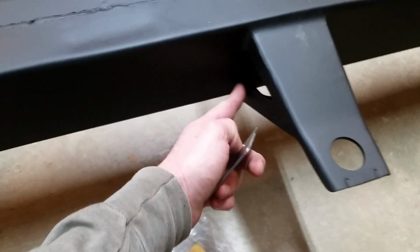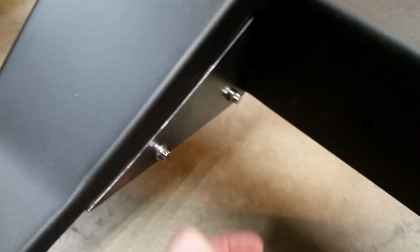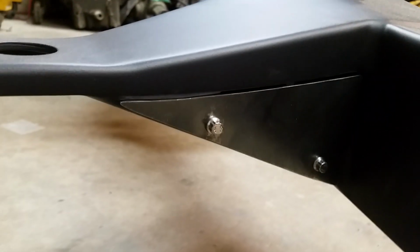I had these made a long time ago, and then I went through and cut the flanges off these body mount edges. Probably easier to see this one. Frame's all dusty, but I beveled these. This is all weld I built up in here, and then I used a ball burr to hone it out a little bit. I had to do a little bitty notch right here to clear the curve because they were sticking out. That's pretty much what they look like when they're on. I left a gap around it for paint buildup, so it wouldn't rattle or chip or scratch or anything. They'll end up looking pretty cool. This one I still have to tweak a little bit on the edge here because it's sticking out at the top just a little bit.